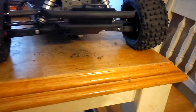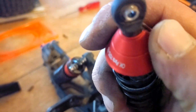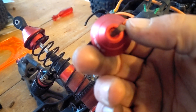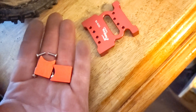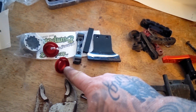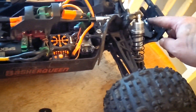Okay, parts coming together. On these shock rod ends, I had to trim the middle black piece down a little bit on each side, but it doesn't even matter because there's a lip inside the ring that holds the whole round piece — so when you trim that little thing down it doesn't matter. Top of the differential holder — last but not least it's got little shims because they're not built in. The front ones I couldn't put on because these shocks have a four millimeter shaft, and the shock cap retainers are only three millimeter, so they did not fit.